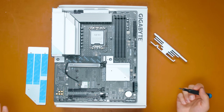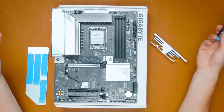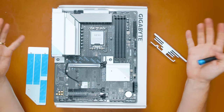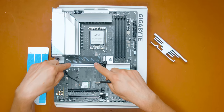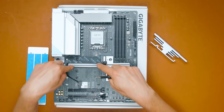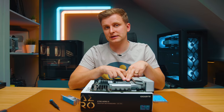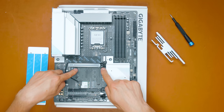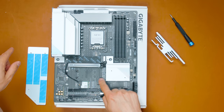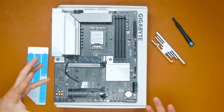Now, interestingly, when you put anything in the top slot here, which you would usually do, everyone has heard, put your OS SSD on the top slot, what will actually happen is this slot starts to run in X8 speed. So you don't have 16 PCIe lanes anymore in there, but just 8. So first of all, you should populate these bottom four, 1, 2, 3, 4, and then that one, the last, if you're running out, which is interesting though.